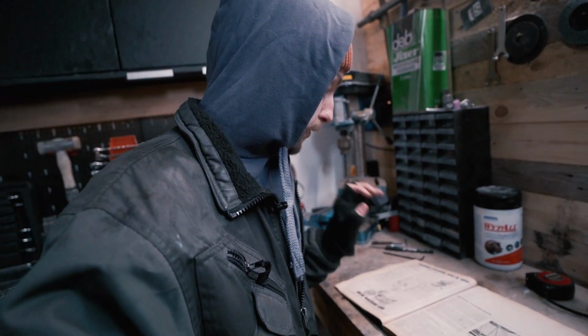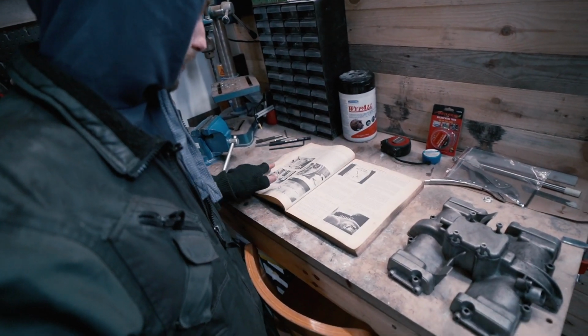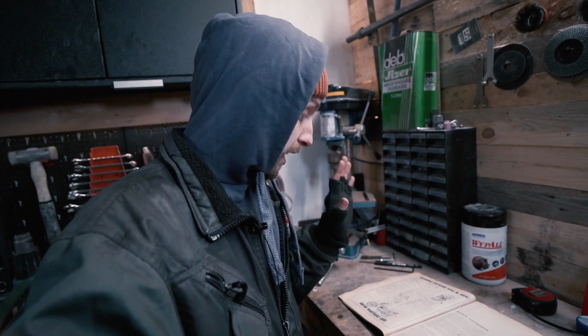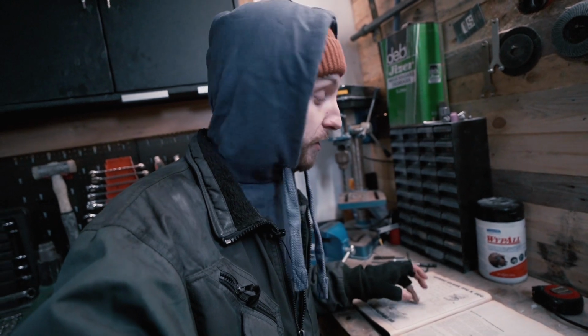So that is the valves all clearance checked and done everything by the book, because I've got myself a Haynes manual and these things are an absolute must when you're building bikes. They give you all the information you need, again, from everything, including the valve clearances. Now I've made sure everything is smack on and I have checked it off camera and the bike is still not sounding great. So yeah, it's time to start looking a bit deeper into the engine and hopefully it's not going to be bores or pistons or something like that. I'm hoping it's going to be the actual tensioner system itself, because remember, this is a 40 plus year bike and parts do wear, springs do lose their tension and so on. So that is going to be the next plan of attack.